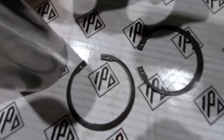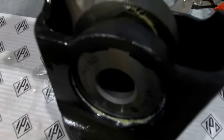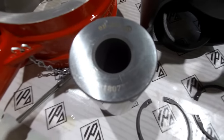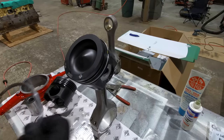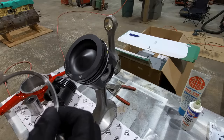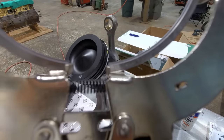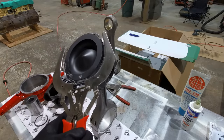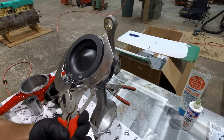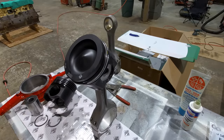There's really nothing to it. You've got two clips, one on each side of the piston. The rod goes up inside of the piston, the pin goes through, and then there's a clip on each side to hold the pin inside of the piston. I've already got the oil control ring on. This is the second ring. These IPD rings are marked with 'up' and numbered, so you really can't screw it up. And then the top ring.